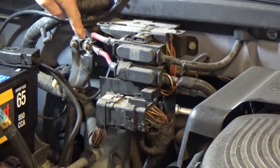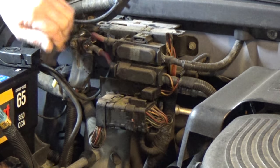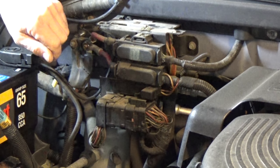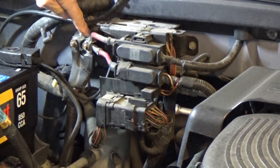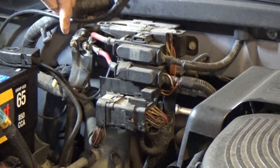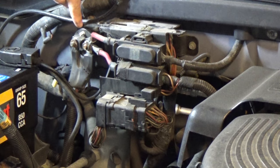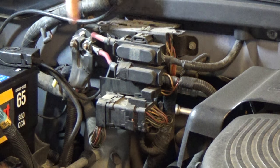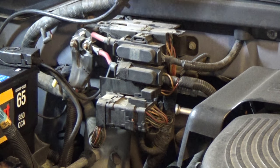What I wanted to say was this truck — I'd go to start it and turn the key, and sometimes I'd just hear clicking, nothing happening, no cranking, and then other times it would kick in. If I put a jump pack on it, I'd actually send a little bit of extra amperage through here and it seemed like it would work then. But I'm going to show you how to bypass all that. Let me grab some tools and a helper for inside there to turn the key. A test light is needed and a little volt meter — all set to go.